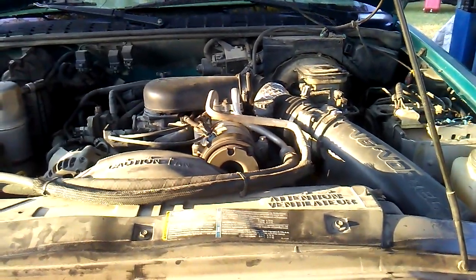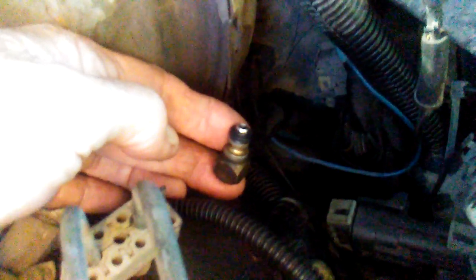There's several ways to do it. On this old hydraulic line right here, all it does is go from the clutch master cylinder down to the slave cylinder. On this vehicle, the slave cylinder is internal in the transmission. You can take this line loose from the slave cylinder off the transmission — I have done that before. But on this one, I'm going to go ahead and leave the line down there on there.